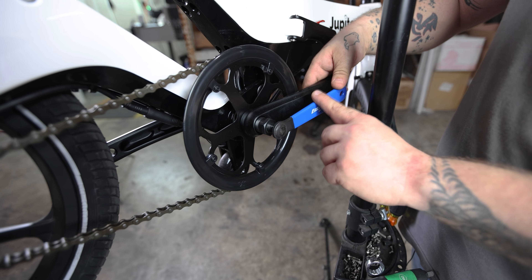To replace your crank, take your new crank, set in your chain, pull it nice and tight, and then set it in the opposite direction of your opposite arm. If your left side arm is in the down position, you want your crank side arm to be in the up position. Once you've got that in place, take your set screw and start screwing it in lightly just to get it started.